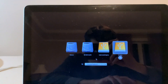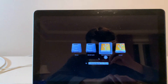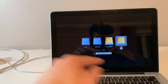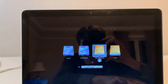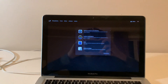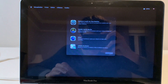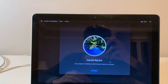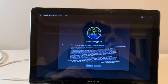If you came from Catalina and chose Clean Install, select EFI boot first — the Mac will shut down, then restart and you choose 'Install macOS Big Sur.' If you're already on Big Sur, go directly to 'Install macOS Big Sur.' Use the arrow keys and press Enter to select it. After about two minutes you'll reach the installer and can use the mouse.